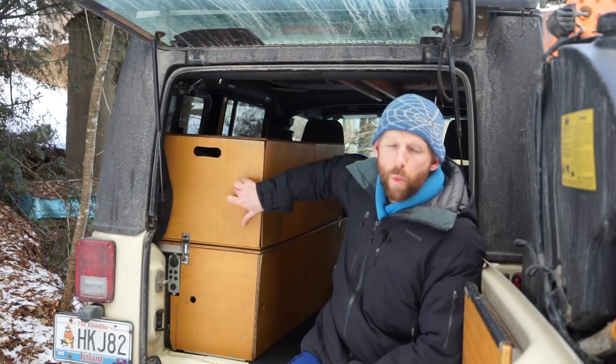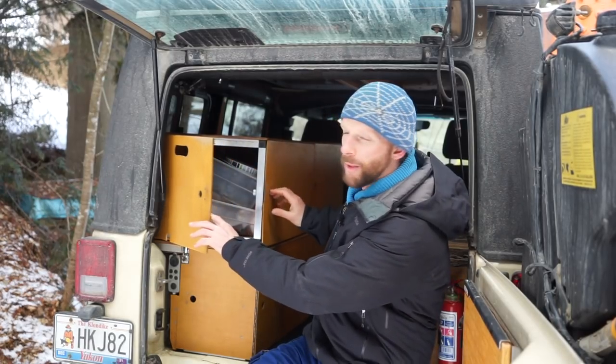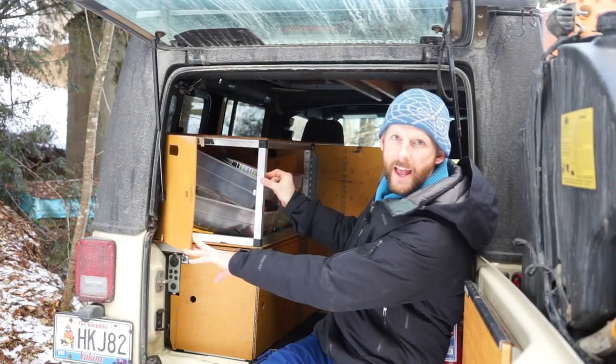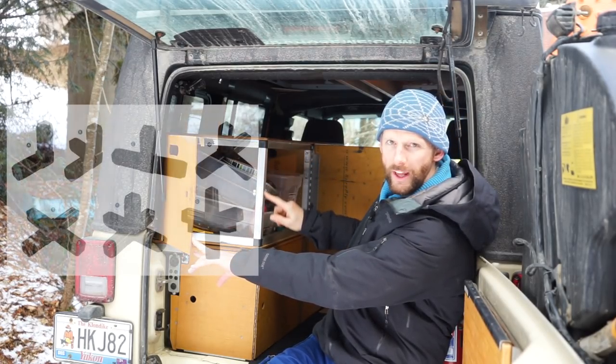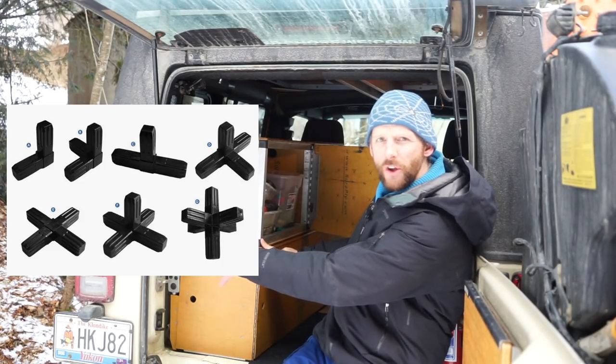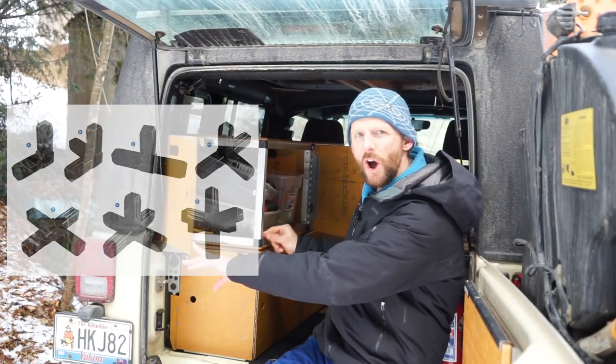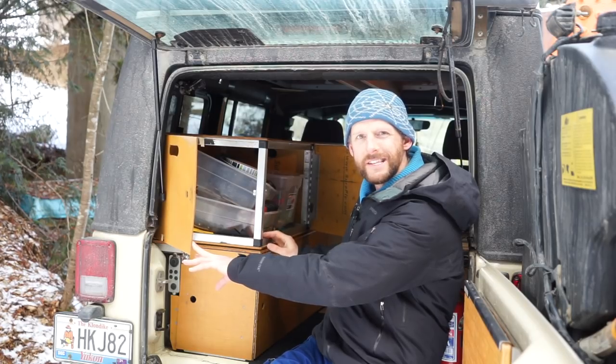So how did I actually build these cabinets? I'm not much of a carpenter — I worried that if I built anything out of timber it just wouldn't wind up square and I'd spend all my time trying to make perfect joints instead of just getting on the trip. So I went with one-inch aluminum tubing, which you can buy from any hardware store. On the corners you can buy plastic corner connectors. They're a little bit hard to find online sometimes — in Australia you can get them from Bunnings, and Amazon carry them at times. I'll put a link in the description.